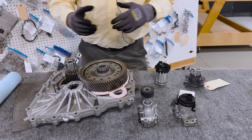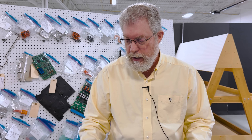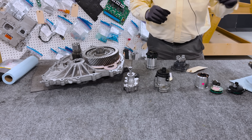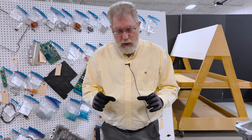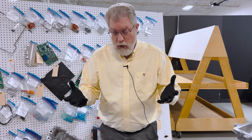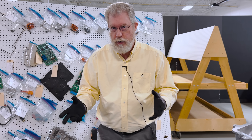You need to circulate oil and cool the motors, so a pump is necessary. In order to lubricate the bearings and gears, you need to flow a little bit of oil. In these kinds of motors, we spray oil on the windings and through the rotor to keep the magnets cool. Oil is fantastic for that because it doesn't conduct electricity, so you can spray it right on the windings. We often use oil to cool electric motors and always use oil to lubricate bearings and gears.